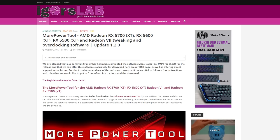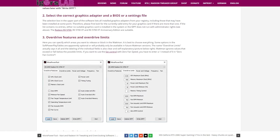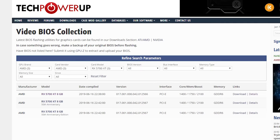I just followed a quick guide from Igor's Lab that uses a tool to modify the power tables to mimic that of the RX 5700 XT. The tool does all the work for you. All you need to do is feed it an RX 5700 XT BIOS, which can be found on a website like TechPowerUp, and that's it. It allows you to overclock with ease afterwards. I'll leave links for more information on this in the description.